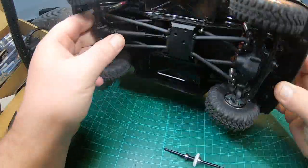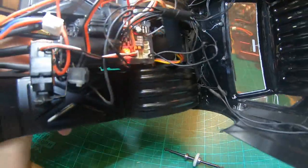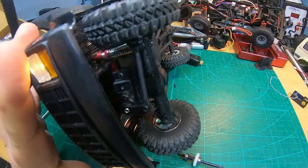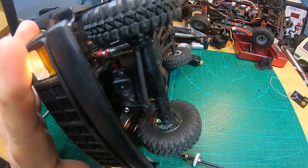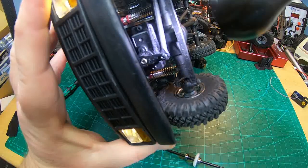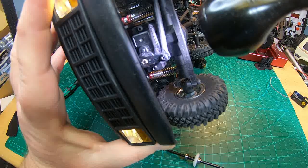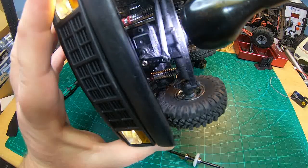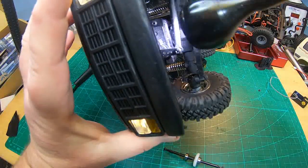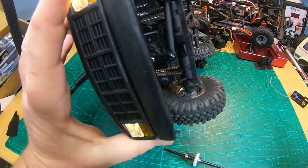And what I did have to do is I had to mount the servo to the axle, what you cannot really see here easily. And there are also always some guys who make, let's find some light, black trucks, what you won't see well in a video. I made a simple servo and axle mount, as I had already shown you for the CR-18 PT Hunter and for the small RGT axles. In the Hobby Plus axles, the screws have to be mounted from backside, not from front side, so simple modifications, and then I printed a servo mount.